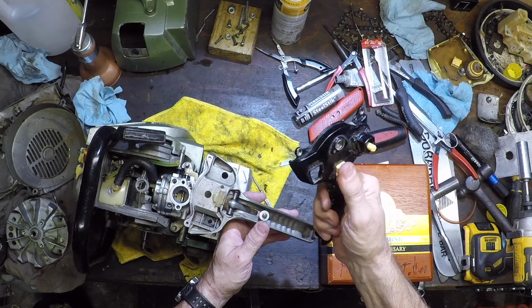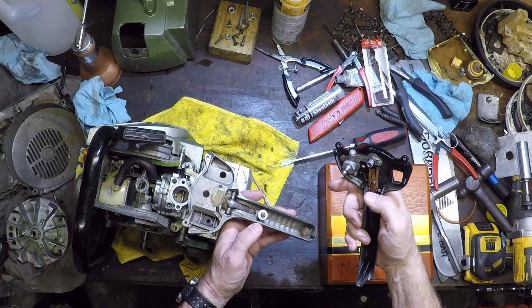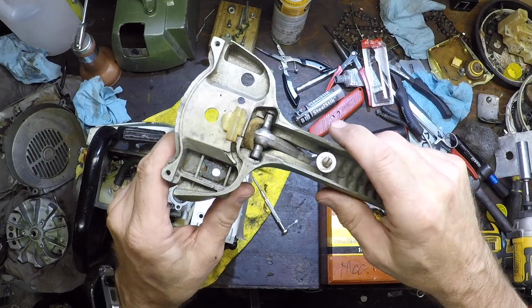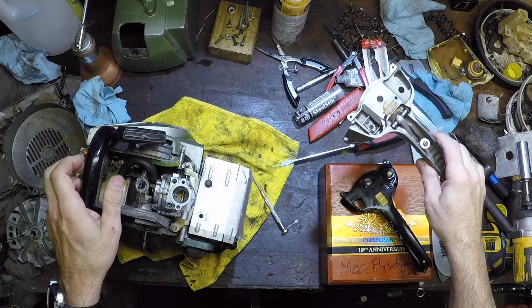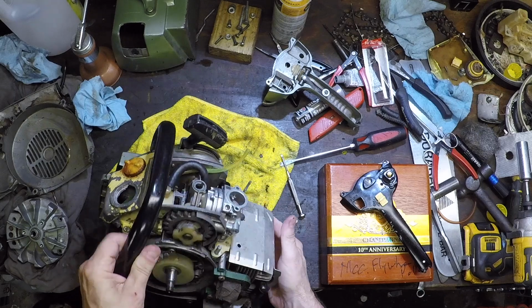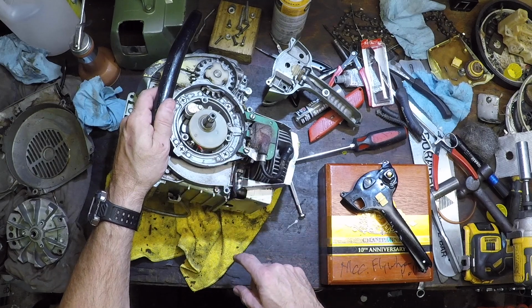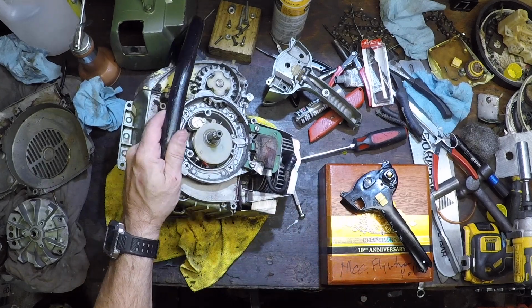Alright, well, you got the on and off switch, but what exactly does it ground to? Don't see a grounding wire or anything. So I'm looking around and check the IPL as well. In there, supposed to be a little bar and a wire that runs down to ground the saw out. Yeah, we worked on it last time. Never put one back. As you can see right here, there's an improvised little fitting on the end. You got the ground for the coil, but no grounding wire itself.